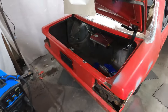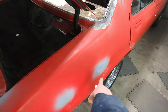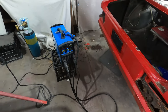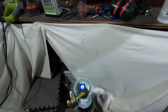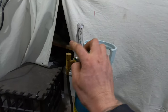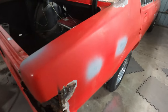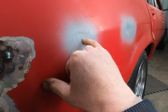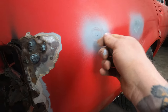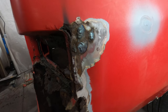There were a couple of holes here from the body molds. That was the first thing I was doing yesterday - I just wanted to play around with the welder. Stupid me - I thought I had the gas turned on, but I actually forgot to turn it on from the regulator. I turned it on at the welder but didn't have it on at the regulator, which is why I was getting some not-the-best welds. I was actually getting some holes in it because of the impurities from not having the gas. So I ground them out and re-welded them.